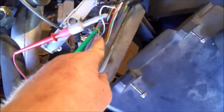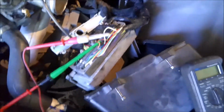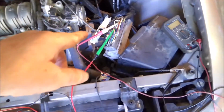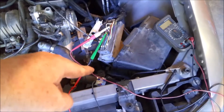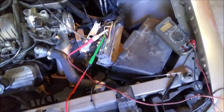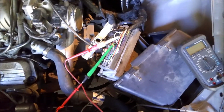But whatever, I checked down the line on this. You can actually see the numbers on the PCM stating 19, 20, 21, whatever. So that was 19, that was 20. Anyway, I looked farther down the row, and a lot of those colors were matching up with my wiring diagram, so I knew I was on the right wire.